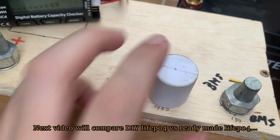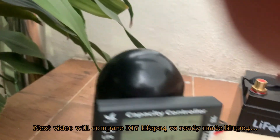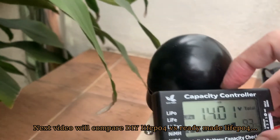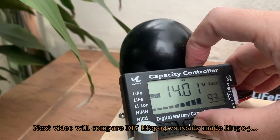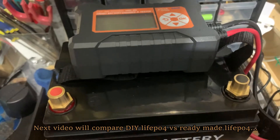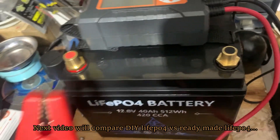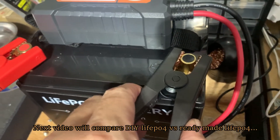Make sure to clean the contact points and have as much contact surface as possible, and use good quality cable and copper plates. So, is it worth making your own 12V LiFePO4 for a car? I would say no — unless you have lots of time to tinker and have experience building batteries. There are a lot of small caveats YouTube videos don't tell you, like choosing the right cable, proper copper plate, proper bolts, and building a correct case that fits your car. Building the case also takes a lot of time. The price is only slightly higher if you factor in the cost for the case. And the CCA will not be maintained if you do not use a good BMS — you will end up paying more than just getting a ready-made 12V LiFePO4.